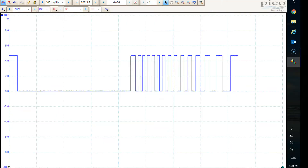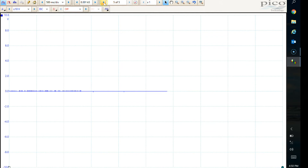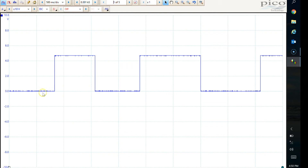It's obviously got a 5-volt supply and I'm going really slowly with the wheel. That's really cool — and then if you give it a spin, awesome stuff. So we have 5 pages there. It's not a self-generating sensor by the looks of it — this one must get a 5-volt supply from the ECU, and basically as the wheel rotates, regardless of speed, it will actually switch at a very very low speed, which is great. That probably also means you're going to get a really accurate slow-speed speedo reading.